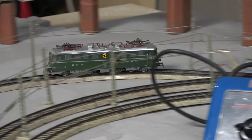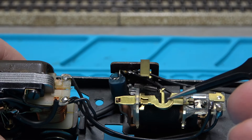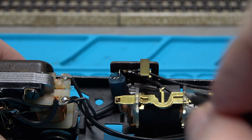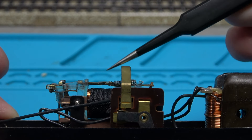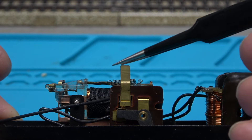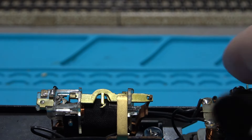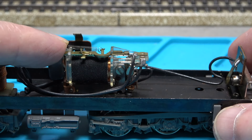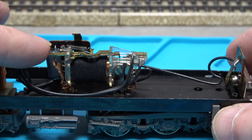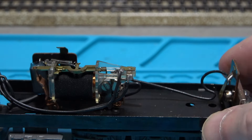A visual inspection is usually a good place to start. The spring should be intact. The arm should be at a 90-degree angle to the rest of the lever and on an even level — not bent up or down. If anything looks different, someone has been tinkering. It is also important to check the unit can change over easily, especially if the plastic around the solder pads for the motor windings looks melted. You can check that by pushing the lever manually — the rocker switch should move to the opposite side every time. If it doesn't, this needs fixing first.